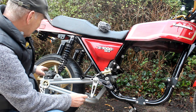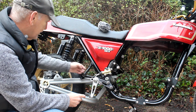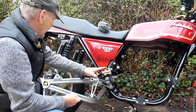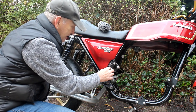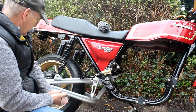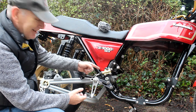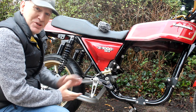I'm not a big fan of these acorn nuts I've used in stainless steel, but that's the look the old Kawasaki Z's used so that's what I've gone for. With that done I can now work out the route and length I need for the rear brake line - it'll probably come down here, behind the frame, and then around to the master cylinder. I've also got to find a mounting for the reservoir, probably behind the side panel alongside the brake line - there's plenty of space there. That's it for this week, as that bracket took me such a long time to make. Thanks for watching - cheers.